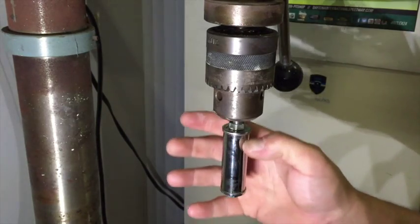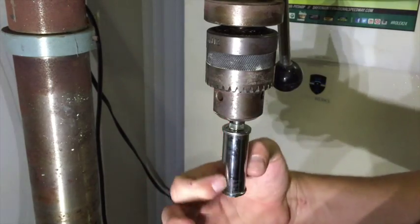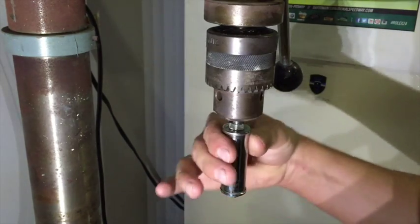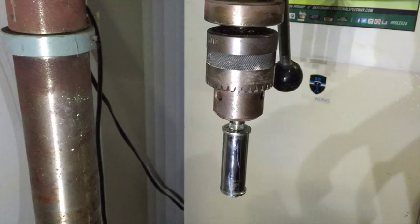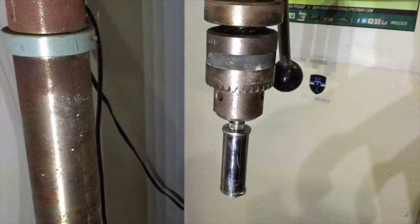I can't feel anything with a thumbnail, so everything is just surface and micro marring — nothing we're worried about as far as putting it back in an engine and making it do its job. A little bit of polish, a microfiber, and chucking the thing up in a drill press, and we were able to restore a probably 1974 part. We'll get this thing cleaned up and show you the final pictures of all six of them.